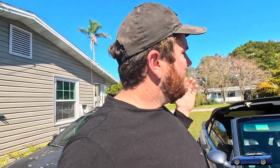So I probably spent, I don't know, $10 on hardware and maybe another 18 bucks on JB Weld. And like I said, it's a 9/64 drill bit. The hardware is about the same size, so 9/64, and just get them with a little pan head, an inch bolts, little pan head, a nut, and a nut on the backside with a washer, and you're good to go. JB Weld the thing tight, and yeah, and then cut it loose.